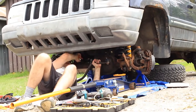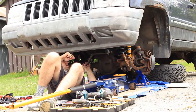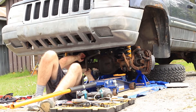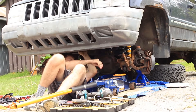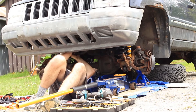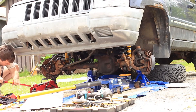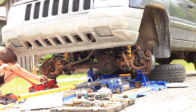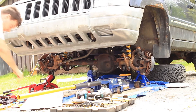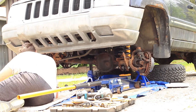Now let's jump back in time to finish this video off. Don't judge my weld too harshly — that's literally the first time I welded anything. If you don't have a welder, the alternative is installing an aftermarket heavy duty track bar, which comes with a larger bolt and requires you to drill out the existing hole making it round again. You can also buy a heavy duty bushing instead, but that requires tools to press the old bushing out. Personally I would just replace the track bar, since on the ZJ the chassis side is a ball joint type which can wear out and is not replaceable anyway.